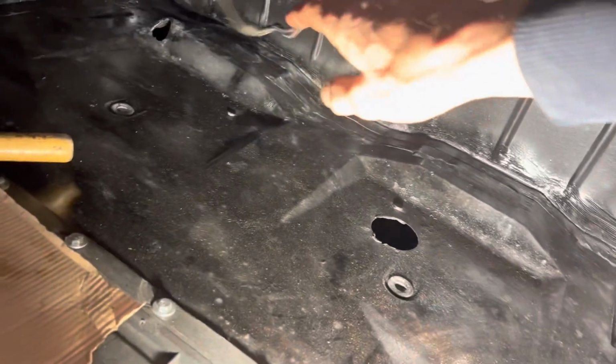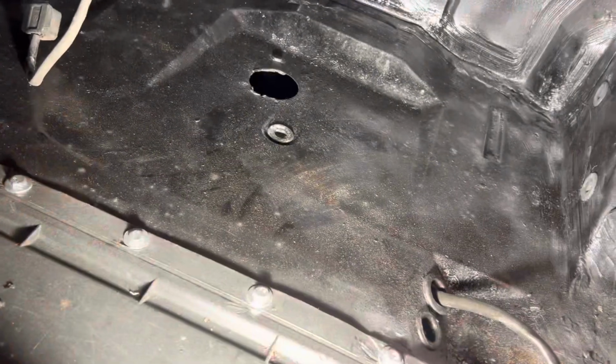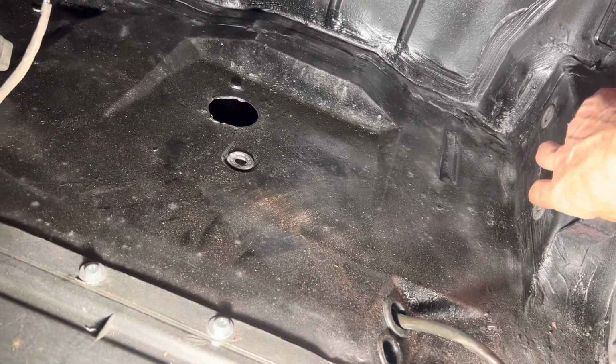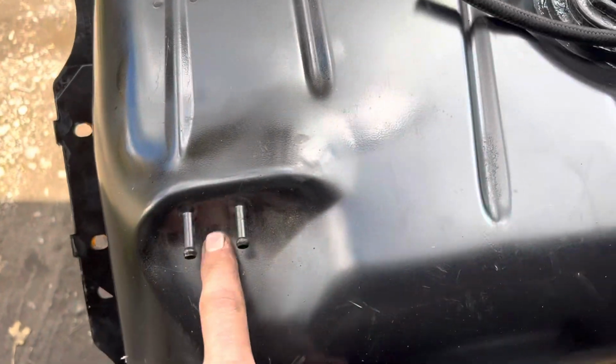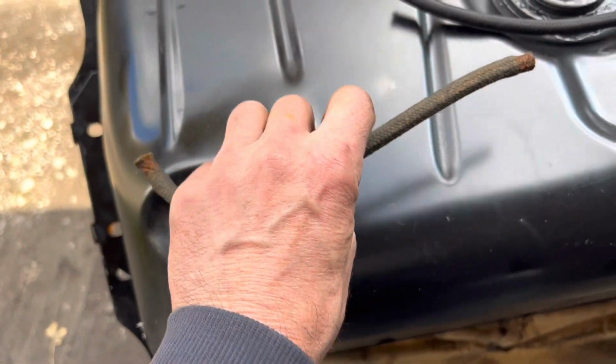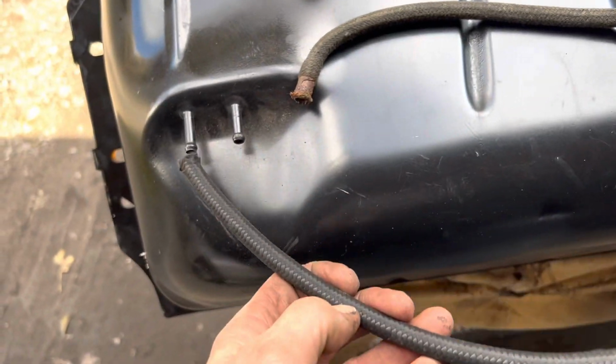That's that grommet in. So next we need to just make sure the fuel sender wires are in the right place, and put the fuel tank in, bolt it down here with some nice stainless steel bolts, and that should be that done. I'm going to install the tank with the hoses that connect to the breather tank attached to it. Now there's 2 lengths of hose here, they're both exactly the same length.